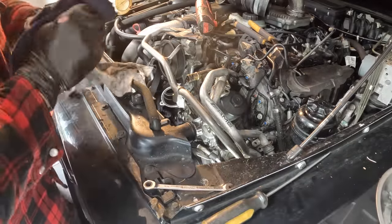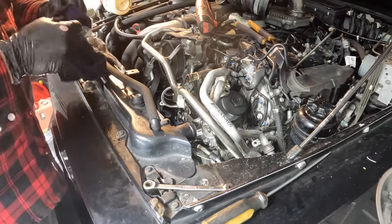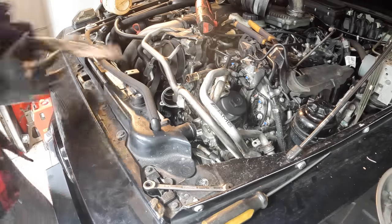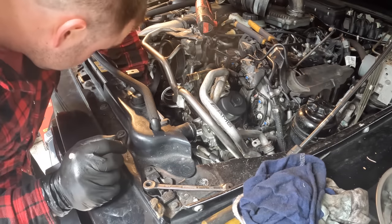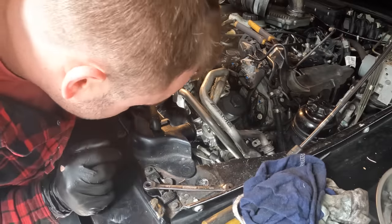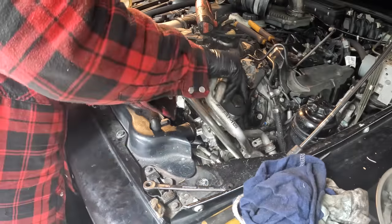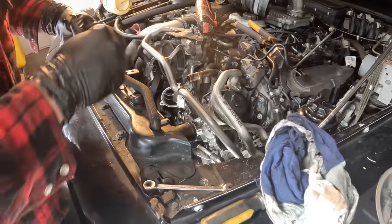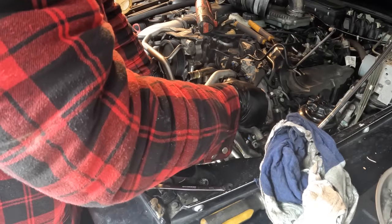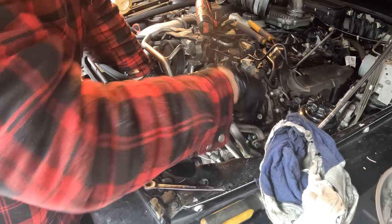This one is the one that came out last from the very bottom. Easy to identify because it was covered in oil. And we'll put a couple of these top ones here just to hold it in place. We want to make sure we got all our bolts in before we tighten any of them. And that way we know all the holes are lined up.